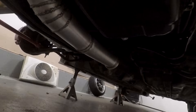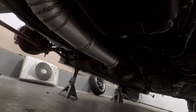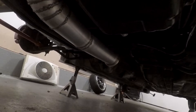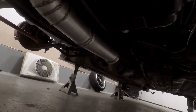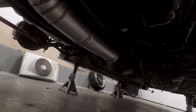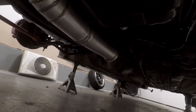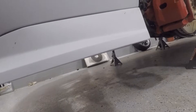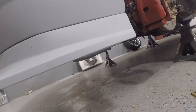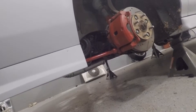It comes down nice and wraps right around the oil pan, and that's where it cuts off — just shy of the rear motor mount. The next piece is going to be a short length of pipe and then a 3-inch flex pipe, which adds a nice flex point since the motor will move with stock mounts. That will prolong the welds and reduce wear on the exhaust overall. The downpipe is now basically the lowest point of the car, so hopefully we don't run into too many clearance issues.